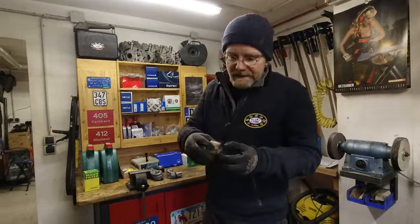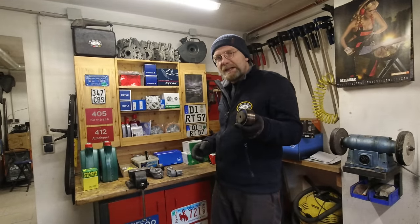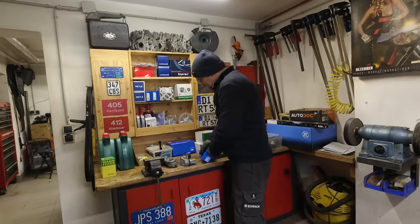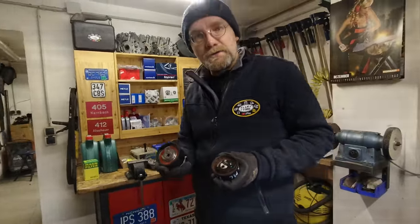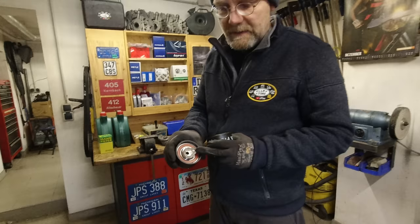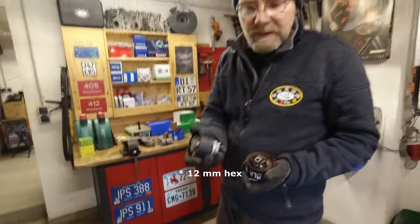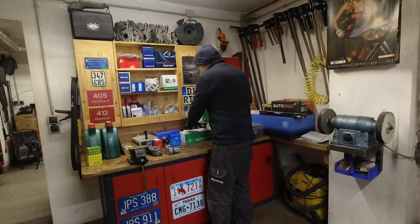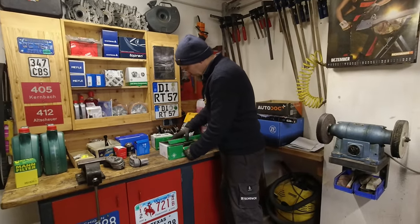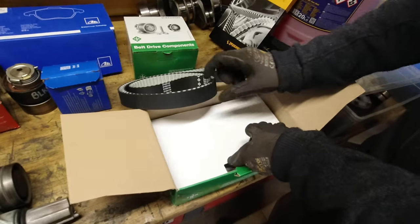I had this one on stock — this is really an inferior spare part. The timing belt idler pulleys — these would probably be fine for another 100,000 kilometers just like in a Toyota. But then we ran into the idler pulley I ordered, which caused me big problems on install. The one I bought from SKF, which is supposed to be a good brand, had only a six-millimeter hex and it twisted right away when tightening. Six versus ten — it doesn't work, you can't get the tightening force. So I went out and bought a timing belt kit — the INA, which exceeds OEM quality on a Land Rover.